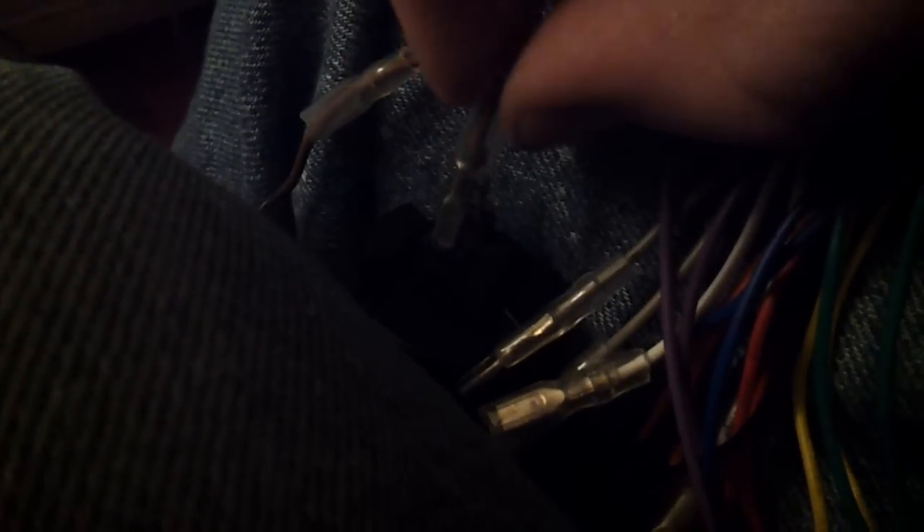Just slide back this plastic sleeving, then grab hold of the metal. Never, ever pull from the wire — grab the metal and pull, and you're going to have to pull hard. You're going to need to gently wiggle back and forth, and then boom, that'll come off just like that. You will be left with your button with the two terminals exposed.